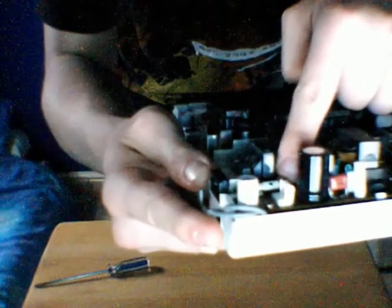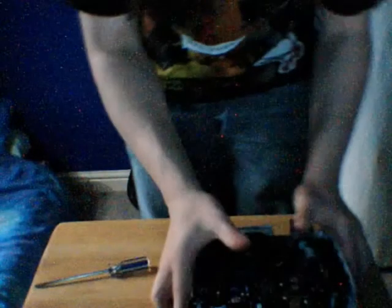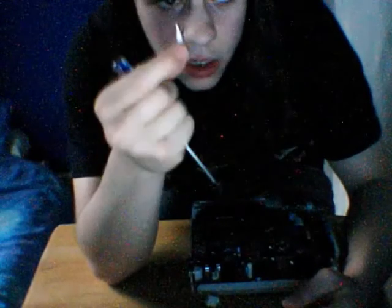See, next to my finger? What you'll need to do is carefully get a screwdriver and just pop this out and it should come out just like that. You'll need to replace this with a two amp fuse. Sometimes this can get damaged after a lot of use or if it gets knocked about, but they tend not to go that often. But if you're having problems with your Dreamcast not powering up, I recommend changing this just to make sure.